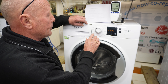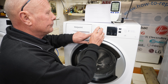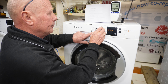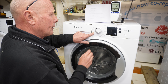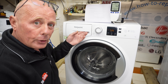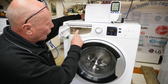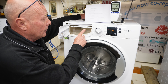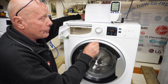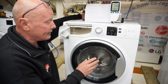Let's go into diagnostic mode. Dial to 12 o'clock, turn it off, making sure it's clear, on, 1 o'clock, off, 12 o'clock, on, 2 o'clock, off, 12 o'clock, on, 11 o'clock, press start. We have now entered diagnostic mode. Opening the soap drawer, you're going to see the water coming through on one valve, then the other valve, then both valves together. One water valve is on — 2 watts for the display plus 8 watts gives us 10 watts. Both water valves are now activated, pulling just under 18 watts. The machine has detected water and turned the heating system on — we're pulling 1780 watts, which is the heating element plus display plus the two water valves.